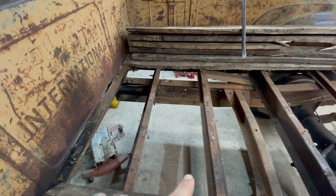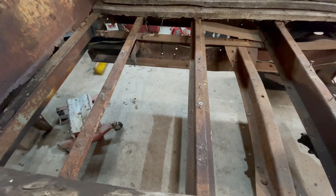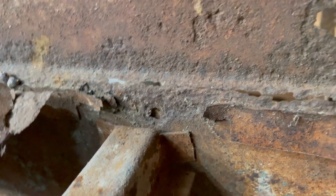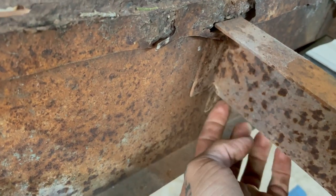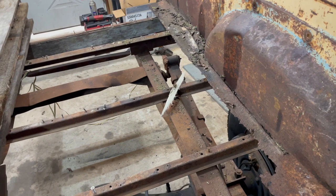The Z channel is shaped like a Z, and the hat channel's cross-section looks like a hat. The way they're connected at the end is that they're cut and flanged out, then spot-welded at the flanges. You can see how they flange out and spot-weld in, flange out, spot-weld in. The Z channels are 54.5 inches across, and the hat channels in between the wheel wells are 48.5 inches.